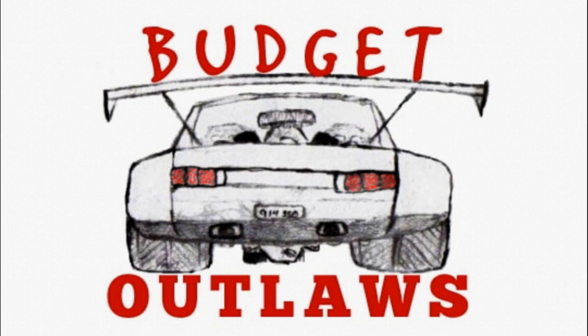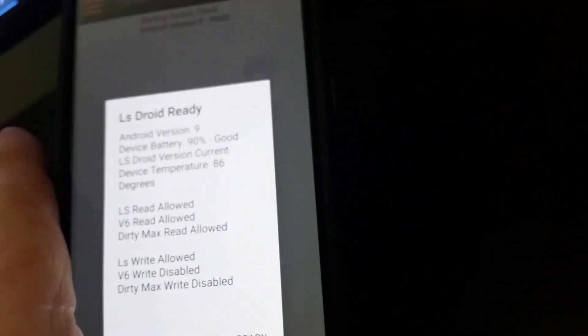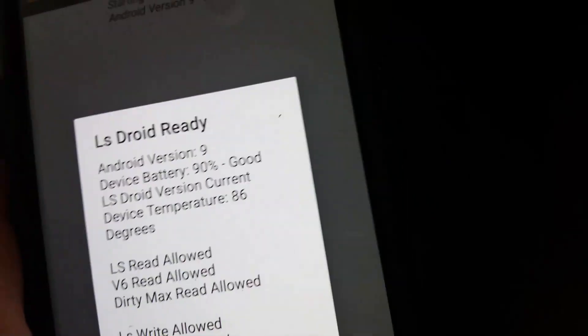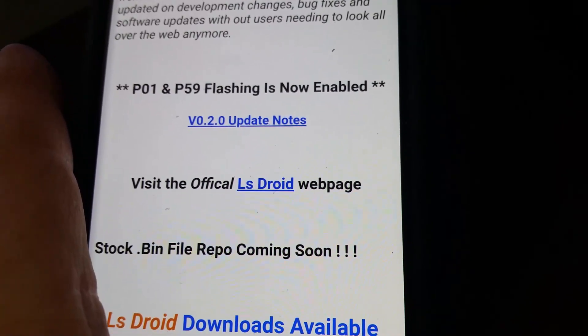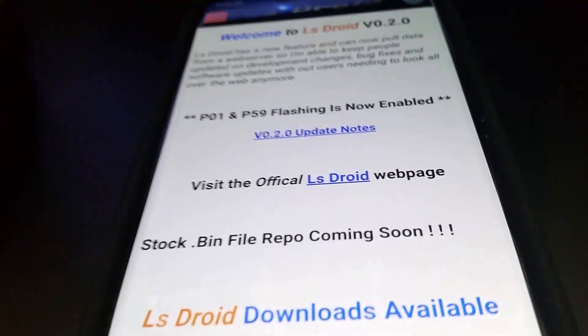I'll break it down into a couple of sections. The first will be little or no cost, and this is more for the stock-ish engine swaps — you just go buy a truck engine out of the junkyard and you want to get it running, because the vehicle anti-theft device would keep it from running. The first thing we need to do is delete the VATS and use the stock wiring. You can delete some of the connectors if you want, going on the websites.